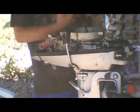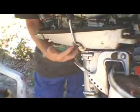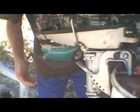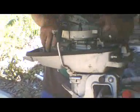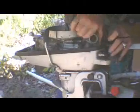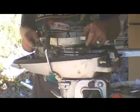and so now you've got the crankshaft. The crankshaft is going this way, and under it you're going to have engine block bolts, in this case about 6 of them. From this side, you take those out, and first you might want to take off the carburetor, which is up front here, just 2 nuts holding it to the engine. Take that off, and it's going to need to be taken apart and cleaned. And then after you've taken your bolts out underneath, this will come right out.